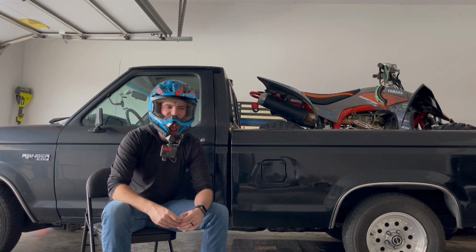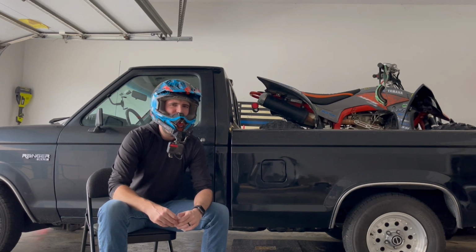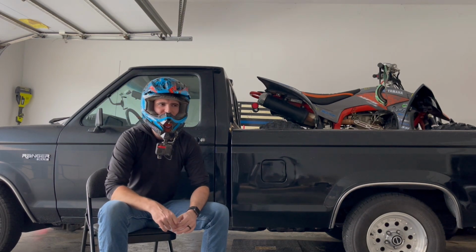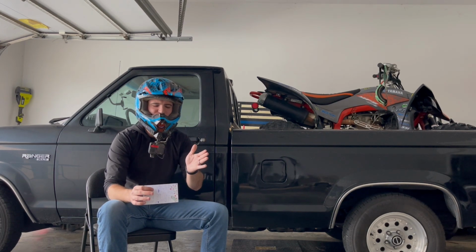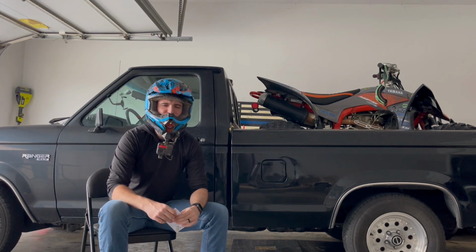Now that I've had some near misses or one crash that you've seen in the Brewer Offroad compound video, I met a tree that I probably wouldn't have met had it not been for me not putting a steering stabilizer on. In the slow motion, you can see my front tire just barely clips it, which yanks the bars out of my hands. A steering stabilizer probably would have prevented that from happening.